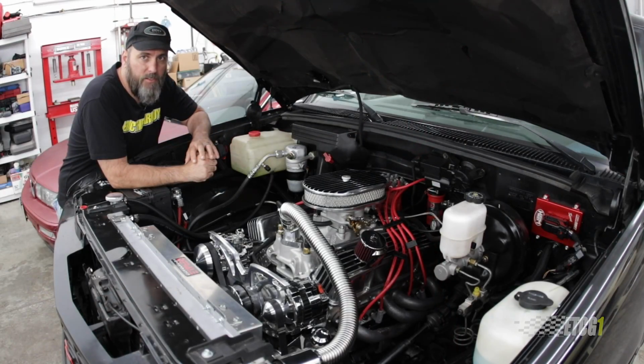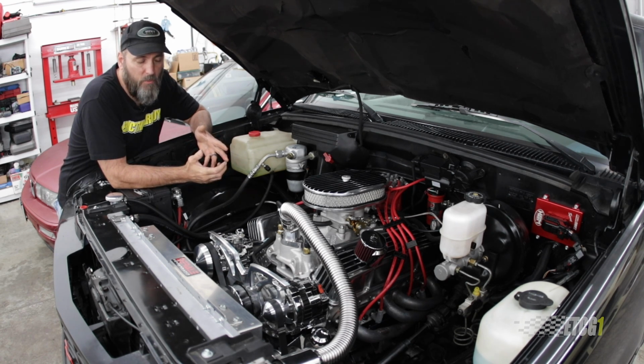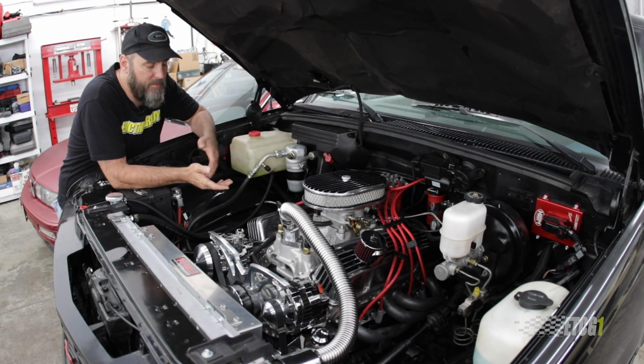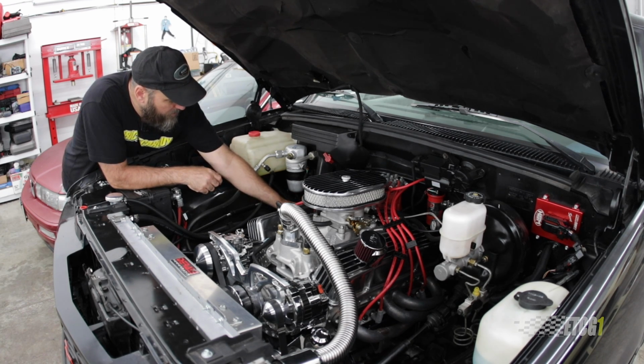Well, I'm hoping that clears up the confusion of why loose flex plate bolts can cause overpressurization of the crankcase and make my dipstick tube blow out. So in other words, the two had nothing to do with one another. I believe the actual issue is I have a combustion leak or blow-by significant enough to cause pressure inside the crankcase, causing an oil leak and causing this dipstick tube to blow out initially.